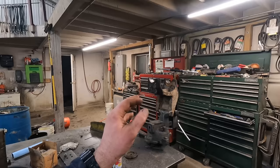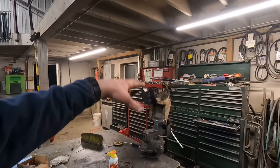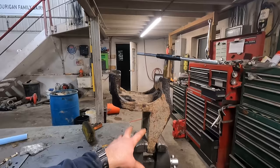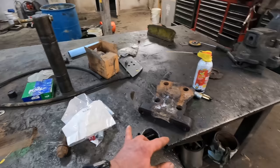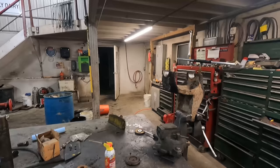I don't want to cross a thread or have rust get in there. Everything came apart relatively easy, but we're just running a tap down in the holes to clean the threads up. The spring sets on the chair, they get bolted in — there's a top plate with three-quarter inch holes on the back side where you put an adjuster bolt to get your spring pack squared up so your axle's not walking sideways. I've got three more holes to do on that chair.